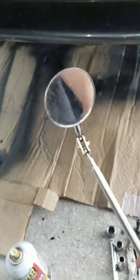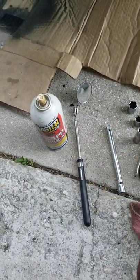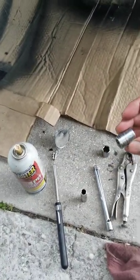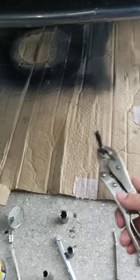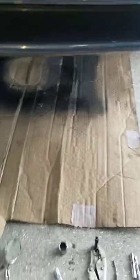For convenience you could have a mirror so you can see the type of mess you're making on top of the dipstick while you're trying to pry it out. You'll also need an extension and 10 millimeter socket — this is for all the oil pan bolts — and a 13 millimeter, which is for the oil pump pickup tube. This is the little piece that's left; I'll show you how I pulled that out.